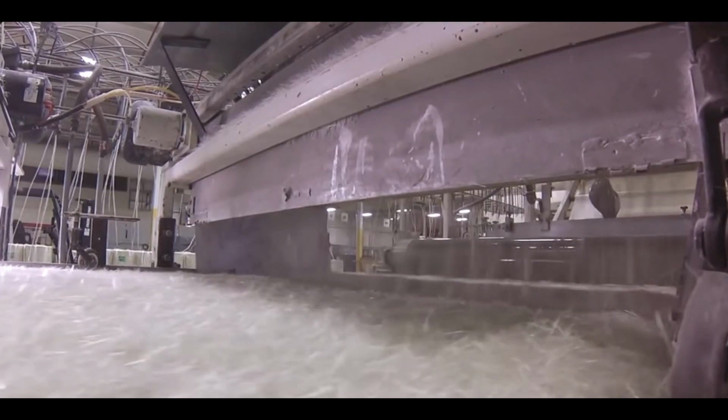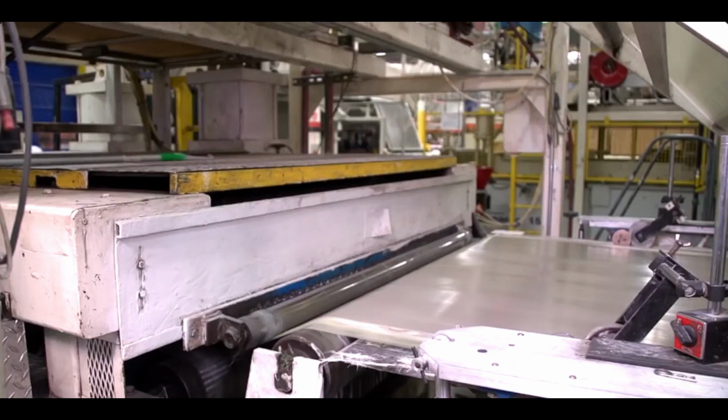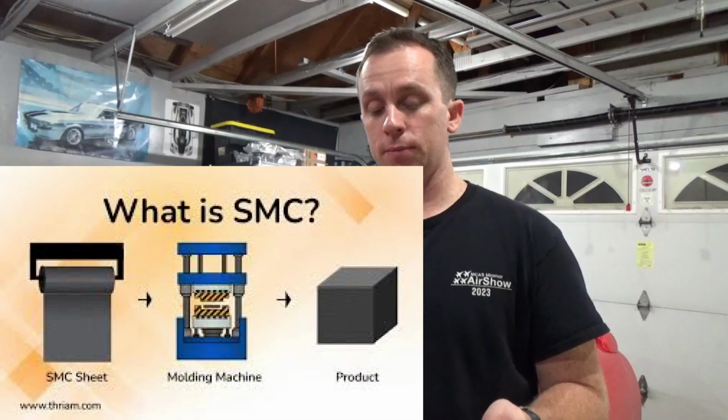The automotive consumer may not even be aware of GM's latest product innovation, a new lightweight composite material called SMC 3374, revolutionizing the structure of the car. It's a plastic material stiff enough to be a structural part and tough enough to withstand the heat of an engine compartment. Latest in a long line of materials known generically as sheet molded composite, or SMC, this new product from the Materials and Processes Laboratory at GM Technical Center reduces the weight and number of parts on the car. The result is better mileage, increased durability, and in some cases added features for the consumer.